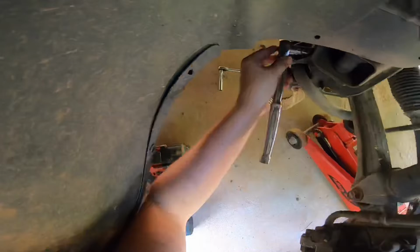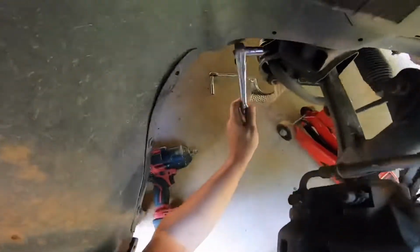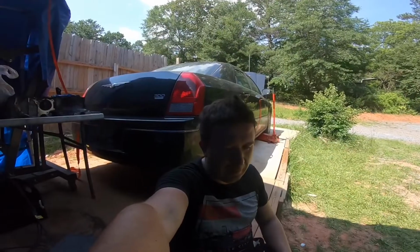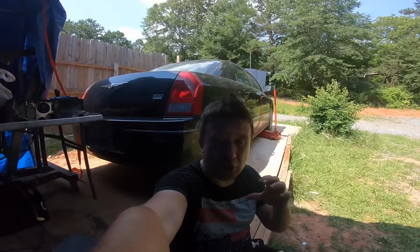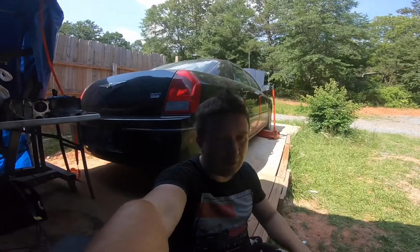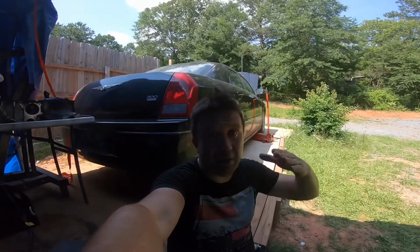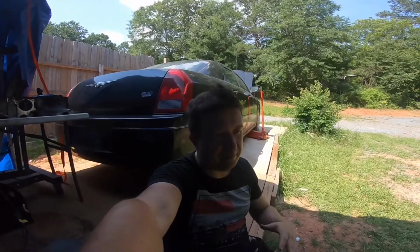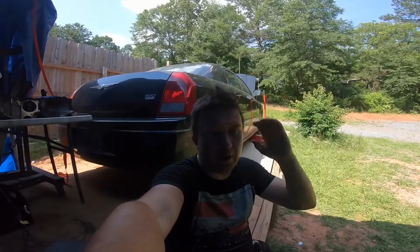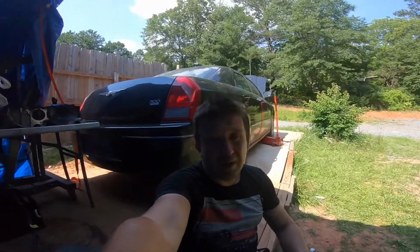It's actually quite easy to fix. What happens is, in certain situations, the portion that holds the sway bar gets misaligned. There's a little rubber bushing, and it gets moved to the side and out of its little cradle, which is made out of metal. Once it gets out of it, metal on metal clanking is what's causing it. But it's nothing serious. All you have to do is take the cradle, separate it, and replace the rubber bushing with the original one that's right there. It just slides down, and that's it.